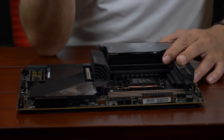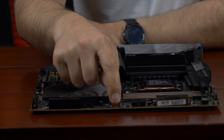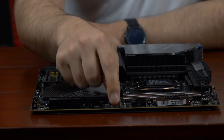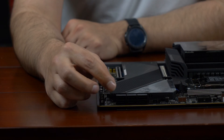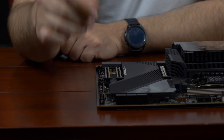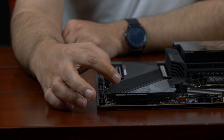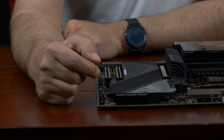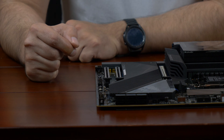When you plug in your pump, you usually start at full speed and then take it lower if you want to reduce wear and tear or noise. You have two headers here — these are USB 3.2 Gen 1, 5 gigabits per second — and they come off a Realtek hub right here. This is one of the two directly routed to the chipset USB 3.2 Gen 2x2 — so two Gen 2 links — giving you 20 gigabits per second. Here you have two types of GPIO headers for Thunderbolt cards. Here you have your SATA connectors — you get six cables so you can fill all these up. Just be aware that this SATA port and the M.2 slot hidden under here share lanes, so if you use the SATA port, the M.2 slot will be disabled. This is also your only M.2 slot with SATA capabilities; the four other slots are all PCIe NVMe.